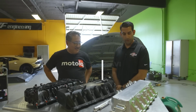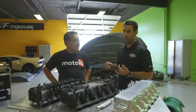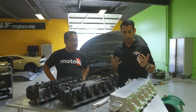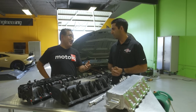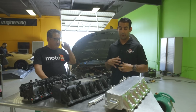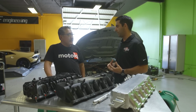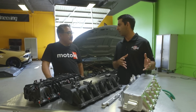So, Mike, I know you and I have worked a lot together, and you've seen a lot of the different cores we've done for oil coolers, obviously radiators, air-to-air intercoolers, and now we're talking about our latest and greatest water-to-air charge cooler. Now, Nick said this is a really trick core, so what do you got going on with it? We spec'd a variation of different cores, wanted to find the absolute lightest and thinnest materials that we could find to be able to make this core, to be able to dissipate the heat as fast as possible.